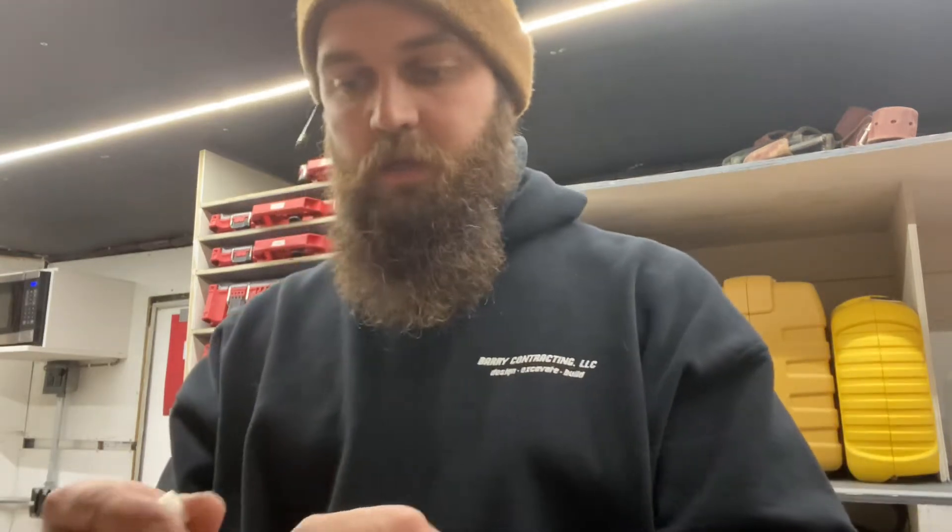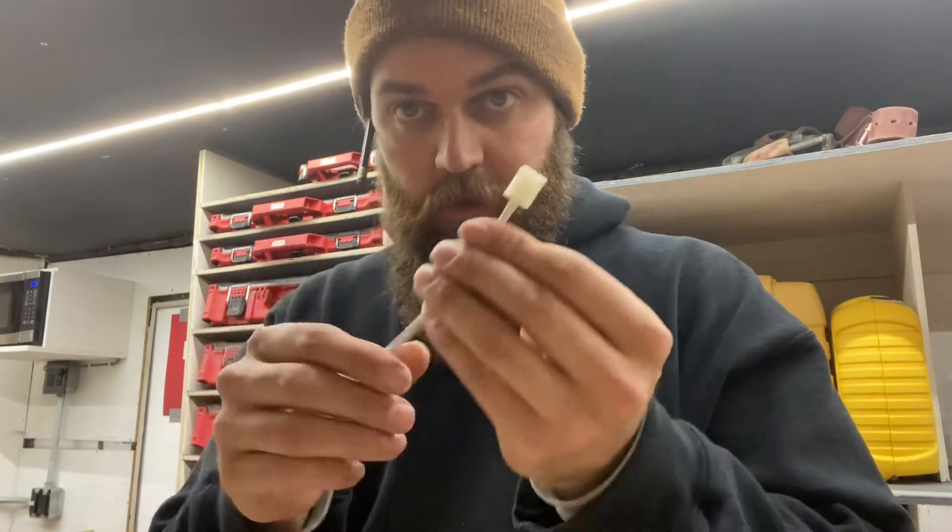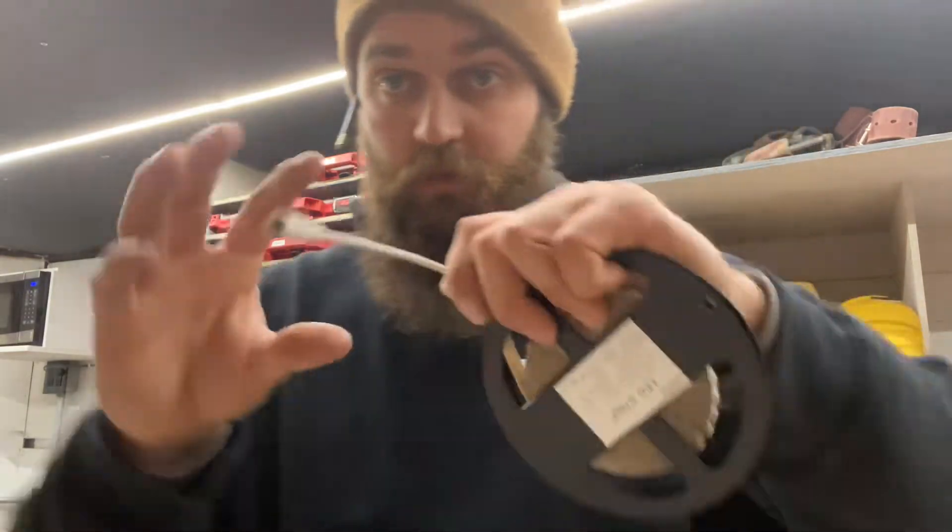There's a little extender kit — it's the style where you put the strip on there and then clamp it down so you can plug two ends together and continue the strand. However, we won't be using any of that. Because we have 12 volt everywhere else in the trailer, I'm going to take the end of the LEDs here and snip this connector off, then strip the wires back. Inside there's just a red and black — positive and ground — strip that back and solder on a new wire that will go to the relay and the switch. So that's all taken care of. Should be easy, not too bad.